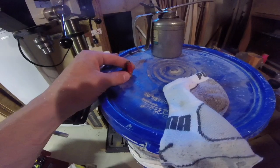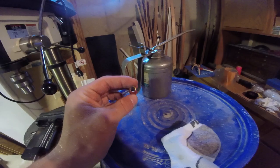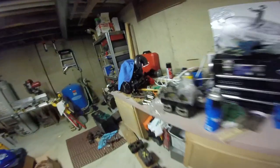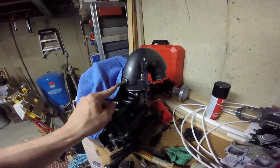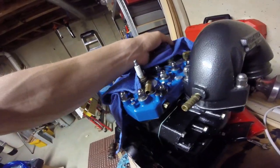Get your quarter-inch drill bit, drill through the fitting to make it a little bit bigger than stock. On my engine there's one fitting here, one at the back, one at the manifold, and then there's also the ones at the head.